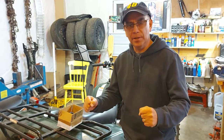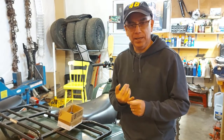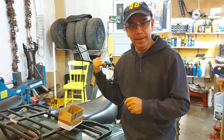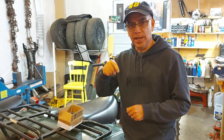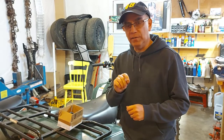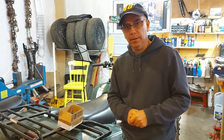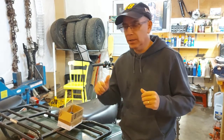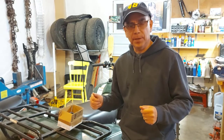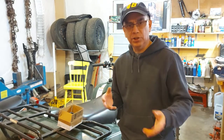When I come to a stop it'll just shut off sometimes, not all the time. I thought I had the issue fixed — I did have a problem with my petcock, I replaced the petcock, and I'll put videos down below in the description where you can see those repairs. That did fix the problem, and then I started having a similar issue — I'd be out cruising around and I'd stop, especially when it got really hot, and it would shut off.